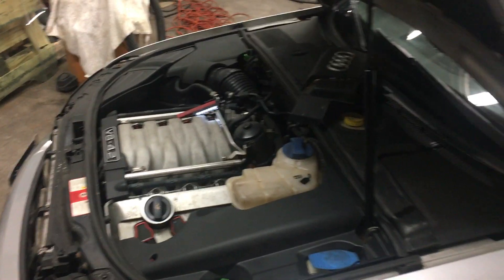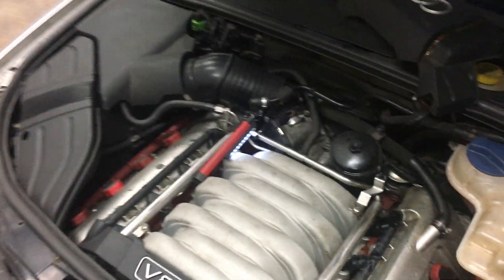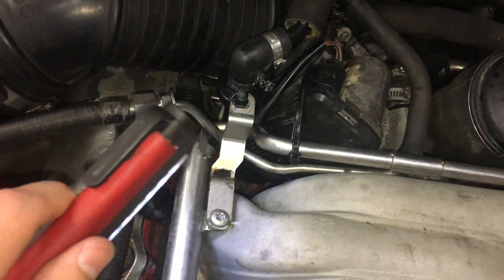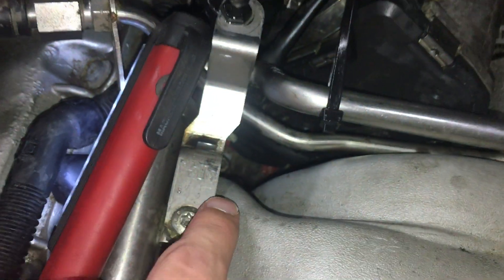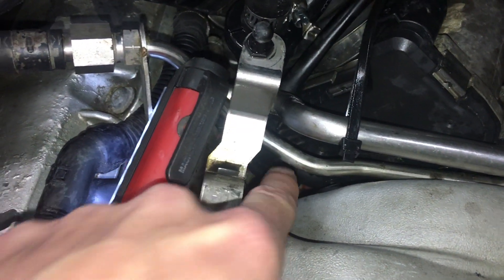I want to show you really quickly here. Let me turn this engine off so that you can actually hear me. I'm trying to make this video nice and short and sweet for you. So after you check your pump, if you potentially still have the code, right here — I'm going to try to put a little light down there. You see these vacuum lines. That white vacuum line going into the black — those oftentimes tend to crack right around there.